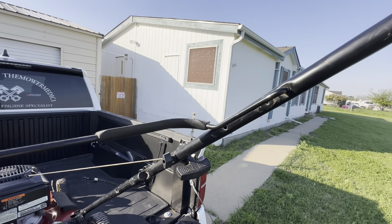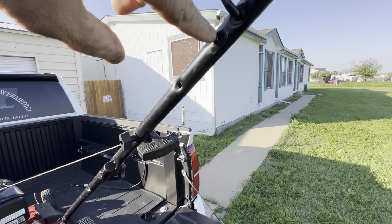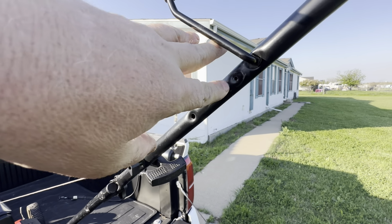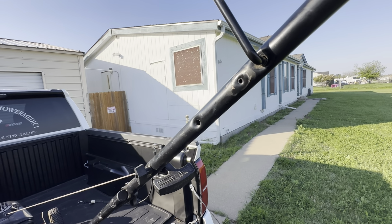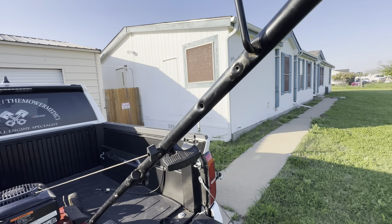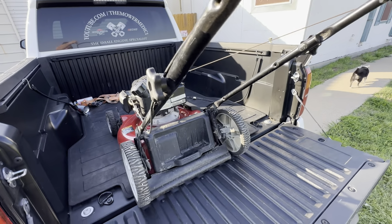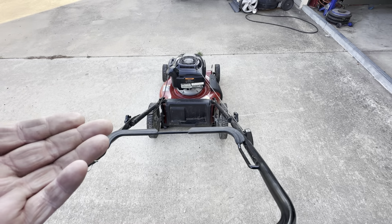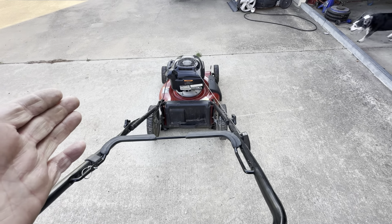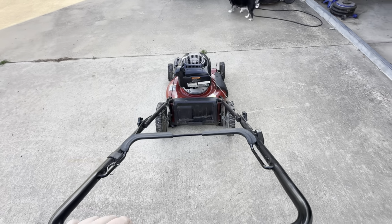First thing I notice is that it's missing the cable or the bail stop. It's just a little flat piece of metal that bolts right here, and they're always vibrating out. I'll have to let him know that that's missing, but that's not going to hinder the operation of the engine. So the complaint is it'll crank up and it'll run on choke, and once it warms up and comes off of choke, the engine just peters out and dies.